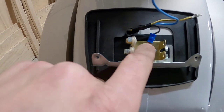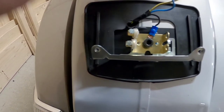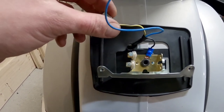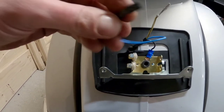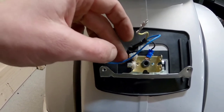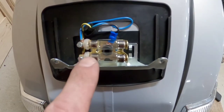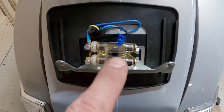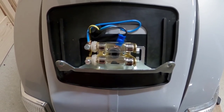I've put the screw here with the wire here. We said that the blue one is for the brake light and the yellow and black is for the rear light. So I will cut these cable shoes off and put the brake light on the top and the rear light on the bottom. Now everything is fitted. I'll put a 10 watt bulb for the brake light and a 5 watt bulb for the rear light. So now we can fit the lens.